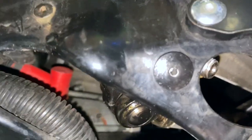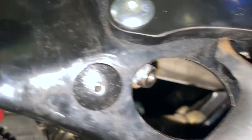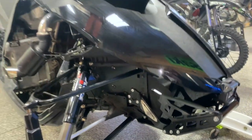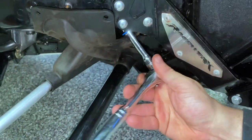If I zoom out here so you can see where I'm looking — just go right up in there with a 15 millimeter, I think is what it is. All you have to do is tighten that up and it should get rid of your play. I got the socket up in there, so you're just going to want to go ahead and tighten that up.